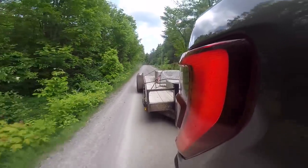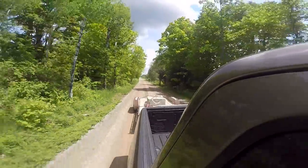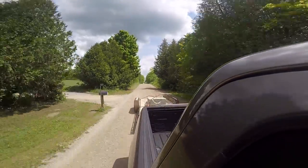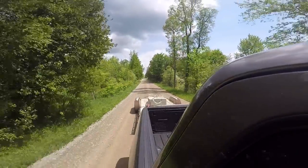When you drop the weight on the back, the rear squats pretty nicely and the nose feels just a hair high. Overall it still feels like a confident towing rig, but a little different than what you'd get out of just an FX4 or standard F-150. The Tremor has a softer suspension — we saw three inches of compression with the 1,100 pounds of mats, about an inch more than a normal F-150. So the ride is a little more floaty, and when you brake hard you get a hobby-horsing thing as you come to a stop. But that's just a trait of the truck.